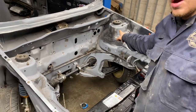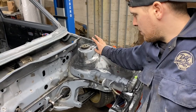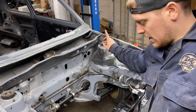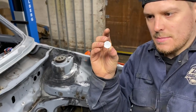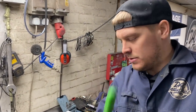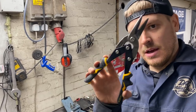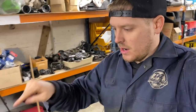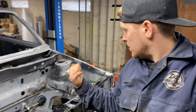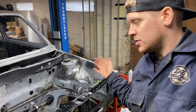Brackets are all out of the car and looking good. I've started cleaning up around this turret area to get the seam sealer off, because it just looks a mess, and for what we're going for we don't really want seam sealer all over that. The next thing to do is start welding up all of these holes. I've gone round and started making some little discs for them using off-cuts of steel, a centre punch, a set of callipers to scratch the metal, and some tin snips. We're cutting them out roughly and tidying them up on the grinder with a sanding disc, then welding them into the car.